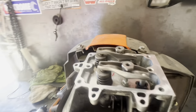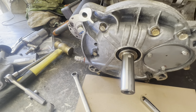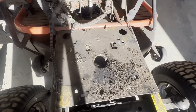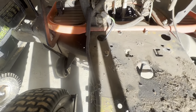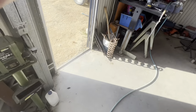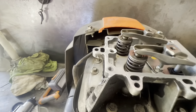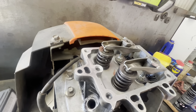Alright, that's pretty well it. I'm just going to put the tappet cover back on. The only other thing I'll do is put a little bit of never-seize on that crankshaft. I won't film putting it back in because that'll be boring for you. I'll just clean the surface off there because if that engine doesn't sit flush it'll come loose if you're vibrating around. Also clean off the points of contact on the engine. I hope that helps someone out. Young fella's going to do a wheelie on his motorbike for you now. Like and subscribe!